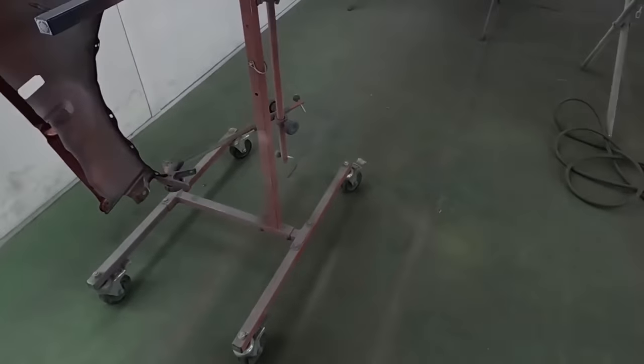We're just finishing up the masking on the car. We decided to go with paper all around. It's just a little bit easier when you're doing an all over because there's so much tape, and you don't have to worry about the plastic sticking and trying to pull it over and the plastic ripping. We're going to be finishing things up here with the pre-painting prep, getting everything clean. We're using the microfiber paper towels, which are really good because they're really absorbent and you can get a few uses out of them, whether you wash them or throw them away. We'll use a pre-painting prep on the whole vehicle and then we're ready to start spraying.